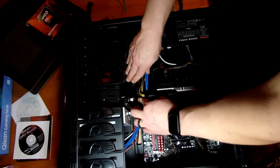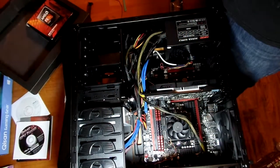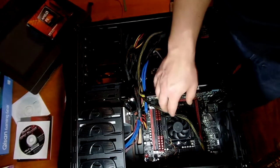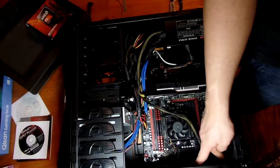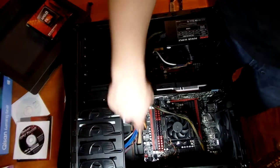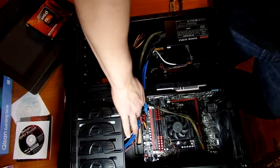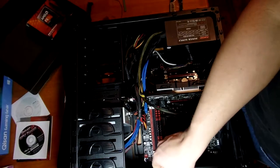Since there's not much we can do with the remaining cables, we're just going to tuck them so everything is in the same area rather than all over the place. We could zip-tie them all in here, but they're not going to move since you don't transport your desktop. To do a quick check: we've got the motherboard, CPU, power supply, heat sink and fan, RAM, fans plugged in, graphics card with power, power supply plugged into everywhere, front panels connected, CD-ROM drive to SATA and power, hard drive to SATA and power. Make sure nothing got loose — confirm all connections are snug. That takes care of the inner hardware.